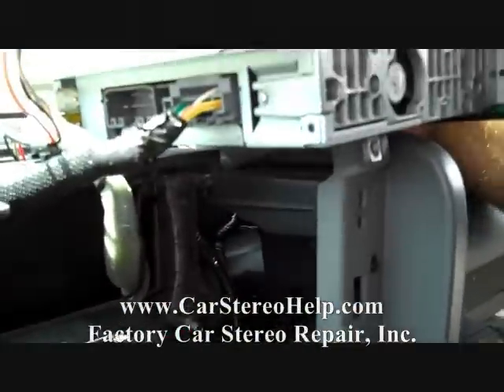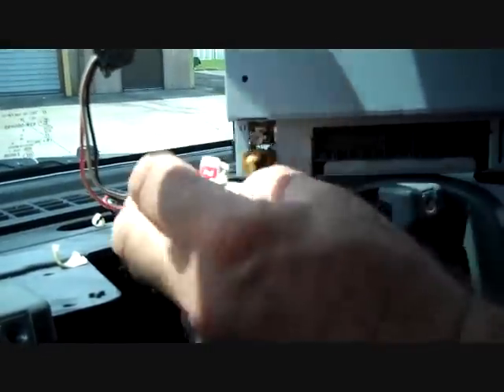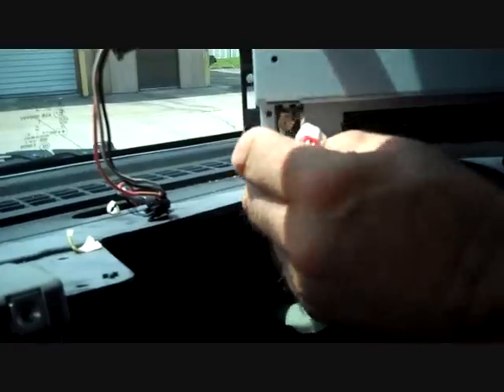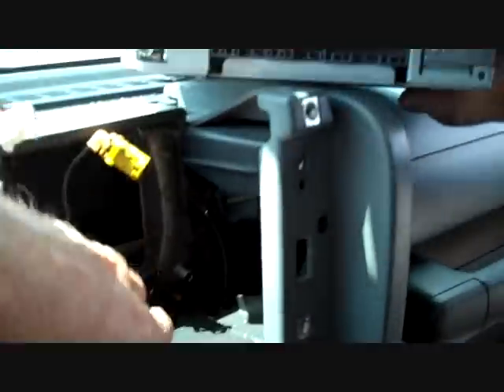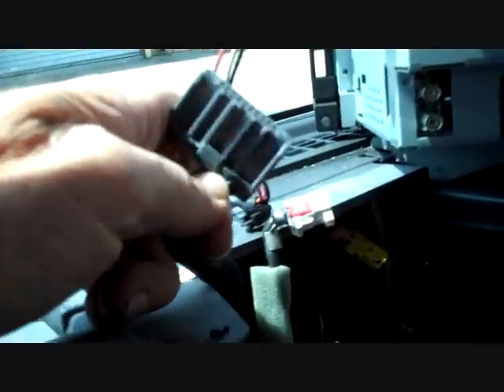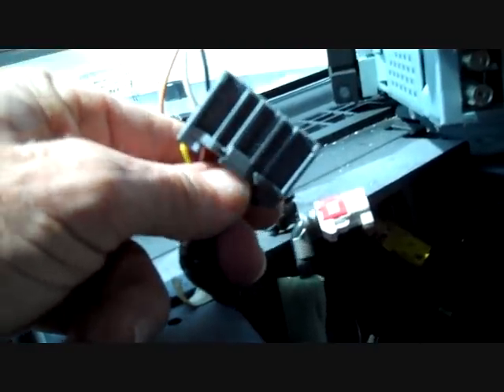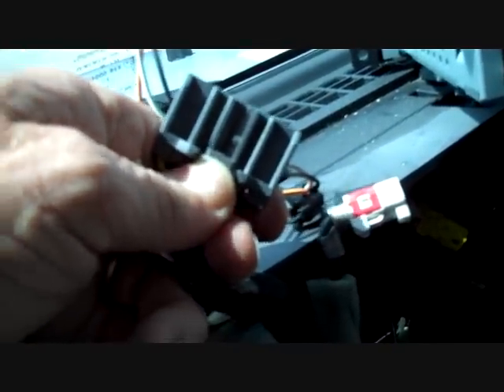This gives access to all the connectors on the back. We have the main connector with a trigger on the bottom of it. With my thumb I can push this trigger down into the connector — that releases the lock and you'll be able to pull the connector out.